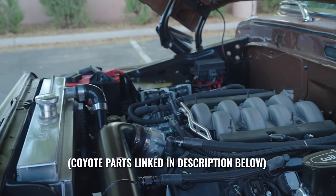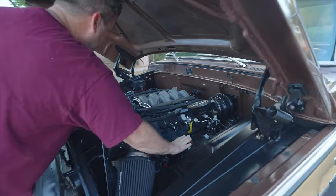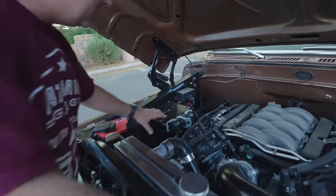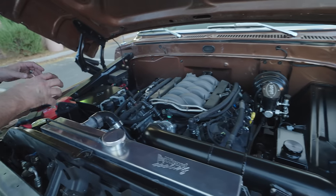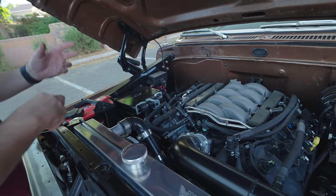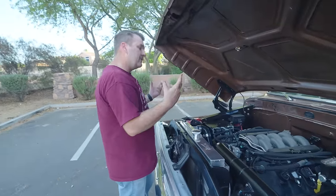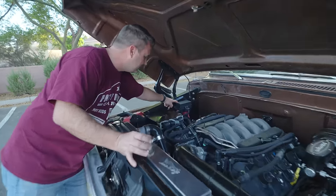Everything is set up and put in a place and location that if you need to service it, you can. Your washer reservoir sits right there, your ECU sits right here. Easy to plug all the wiring in because on a Mustang your ECU is right here as well, and you don't have a lot of room. If you're using the Ford Racing control pack, it kind of forces you to put it in this location unless you want to cut the loom back, fold it back and maybe get it underneath the dash. You can do that, but a lot more work. Right here, it works pretty good. This is the fused block that you get with the control pack.